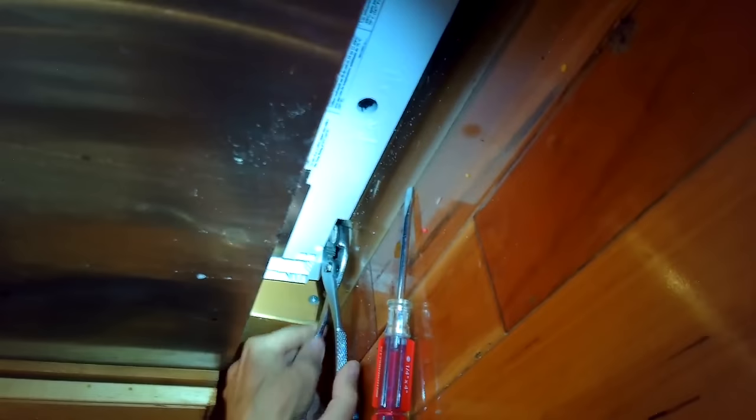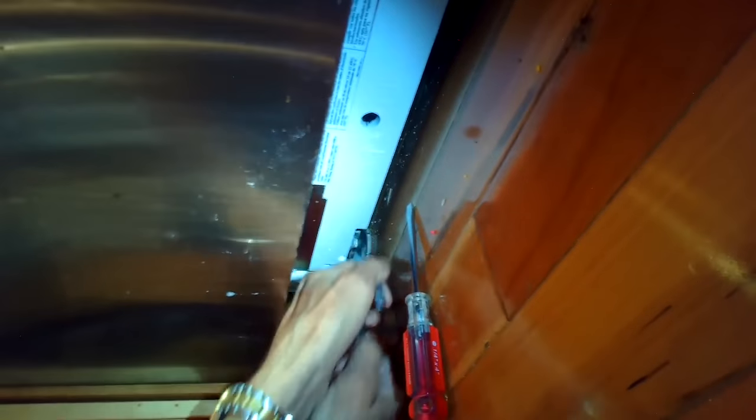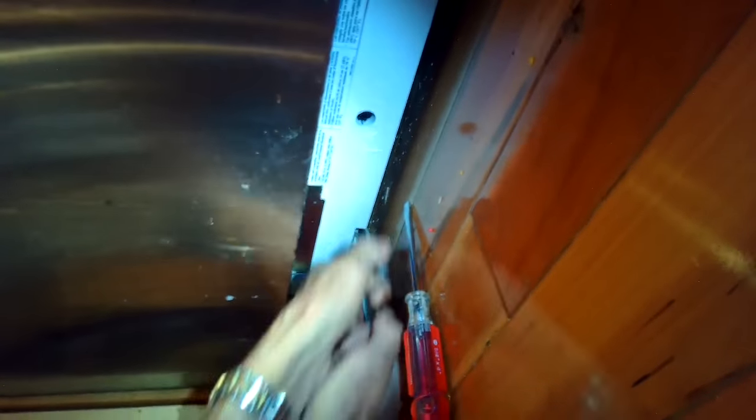Get this plate out of the way, then we're going to use a wrench to lower the legs by turning them to the right — they go into the dishwasher and that lowers the front down. To get the back of it to go down, we use a standard head screwdriver and turn one little nut to the left, and that lets the back legs come down.